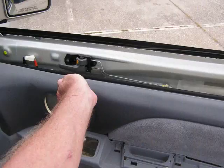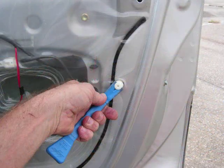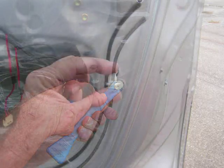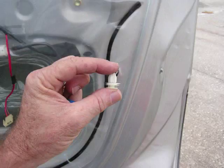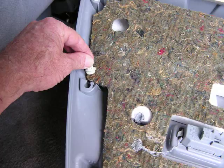We're going to pull the top edge of the panel back because we still have the courtesy light on this panel. Locate the connector and trigger, release this connector and remove the door panel. As usual, we're going to check the door to be sure all clips are removed with the door panel. Pry these clips from the door panel and place them back in their corresponding spots on the door panel. They clip in, ready for installation.